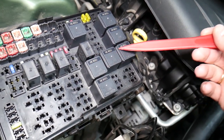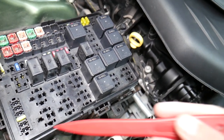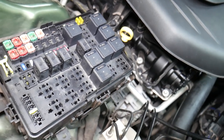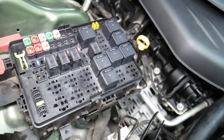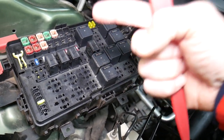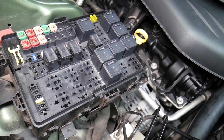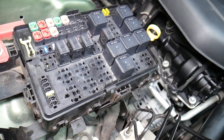The same thing for relays — some of those could be really expensive on cars. We'll put a link in the description below on how you can test relays. For some certain fuses, it's important to disconnect the car battery when removing them, otherwise you can burn the electronics. For instance, when working on airbags or fuses like that, you need to wait at least one hour after disconnecting the car battery. And if you're not qualified and certified to work on an airbag system, I would never recommend doing that. When disconnecting the car battery, it's important to know which battery terminal you disconnect and reconnect first. If you do it the wrong way, you can burn electronics modules — we burned the traction control module on a BMW that cost $2,000. We'll put a link in the description below on which battery terminal to disconnect first.